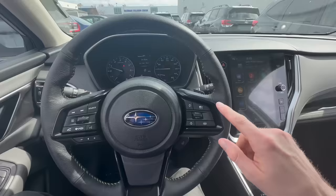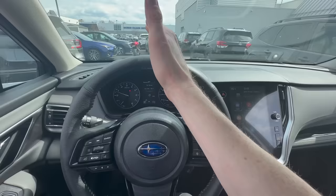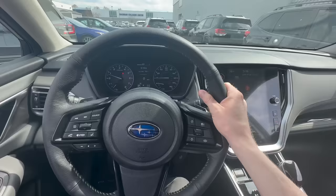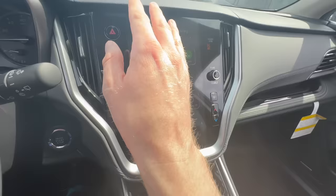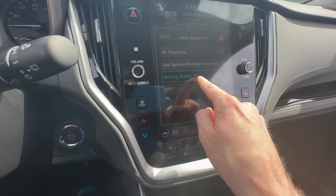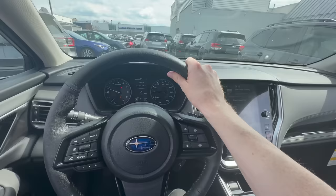The next common mistake is with lane departure controls. On your steering wheel there's a button with a steering wheel icon. A lot of people think this turns on and off the lane departure alert — the beeping noise when you get too close to the left or right side of the lane — but that's not the case. This just turns on lane centering, which guides you left and right to keep you centered. To turn off the alert beep, go into car settings, scroll to driving assistance, go to lane departure, and turn off the buzzer. You can turn it back on any time if you prefer that safety feature.